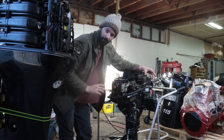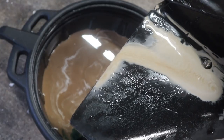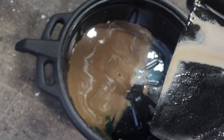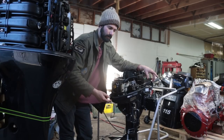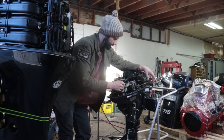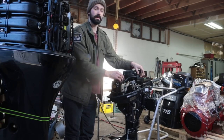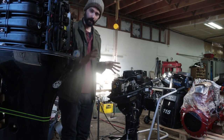Love this girl, but we got water in the oil somehow. I noticed it because the exhaust, especially on startup, started getting quite smoky. I checked the oil and of course it's milky. It's not just water having got in once, but it's consistently getting in, because it's actually forcing the oil through the PCV into the intake manifold. So there's a bad seal in here somewhere. We've got to find it.